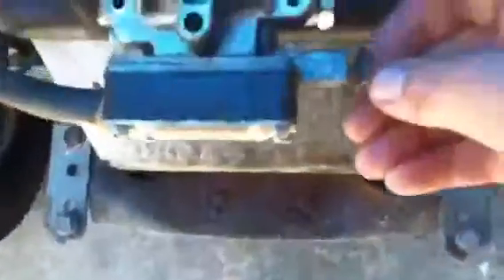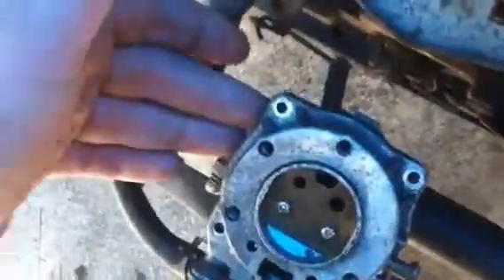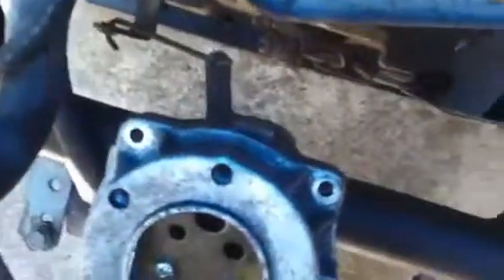You need an 8mm socket to loosen this. You don't have to take it all the way out. Then once you do that, you have the four screws on top. I suggest, before you take it off, douse it in gasoline because that wets the gasket and makes it better to come off without damage if you want to salvage your gasket. It also makes it easier for cleanup. I break them free in a sequence then take them out, because this is cast and you really don't want to break it.